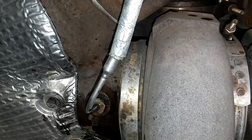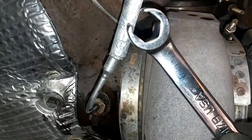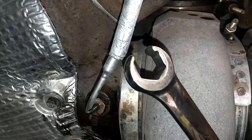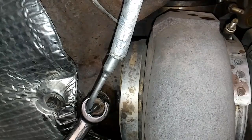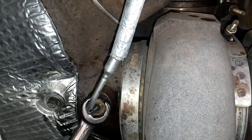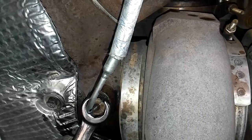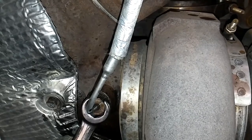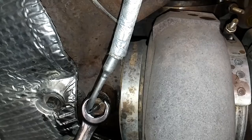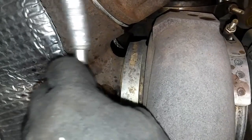What we're looking at here is your turbo outlet temperature sensor, also called EGT1. When you go to loosen this, you don't want to use a normal wrench — you want to use a flare nut wrench, which grips more than just two flats and encases the probe nut. This probe nut was seized and was a real pain to get off, but once it broke loose we were able to remove it.